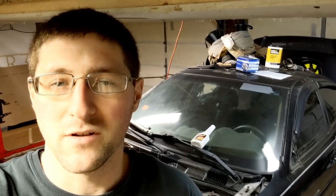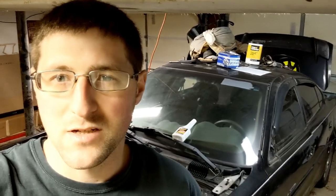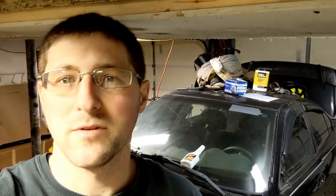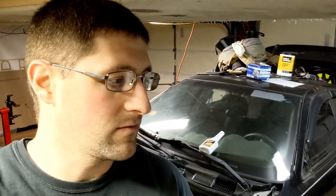I recommend that if you're going to put an aftermarket radio in with the Monsoon system, go ahead and just run all new wiring through the car with new speakers. That way you cut out any issues that can happen, because sending a signal to the Monsoon amp, out to the speakers, you can find any kind of trouble there. But yeah, pretty simple one here.